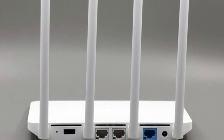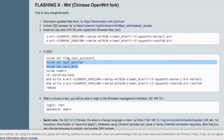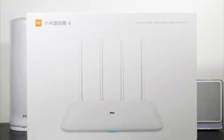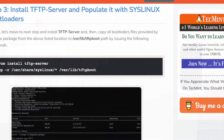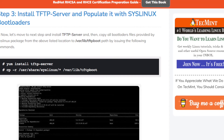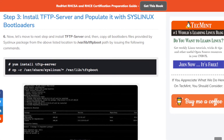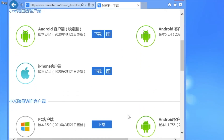It's like a cruel girlfriend — it will never come back if you make a mistake. Also, the bootloader is locked by default, so you can't flash firmware from the serial console. I suggest you first unlock the bootloader for this device if you have access to the stock firmware — just add the environment variable in UBOOT RAM and the bootloader is unlocked. The first generation and following generations of MiWiFi routers mostly accept stock firmware from TFTP after booting into recovery mode, similar to the PXE feature on Ubuntu servers where you can load the operating system from a local network. If you're not sure how to set up DHCP and TFTP servers, you can download the official repair tool from the manufacturer's website to do the job.